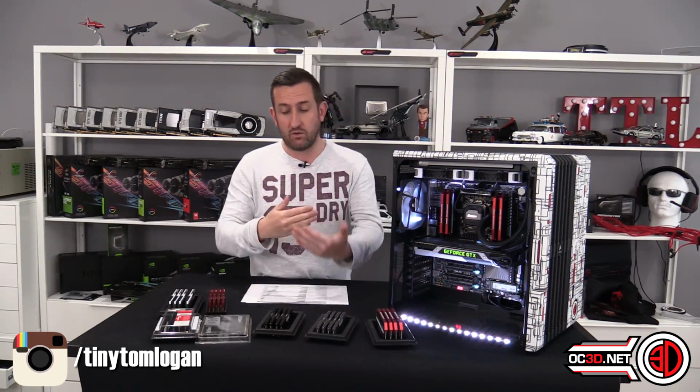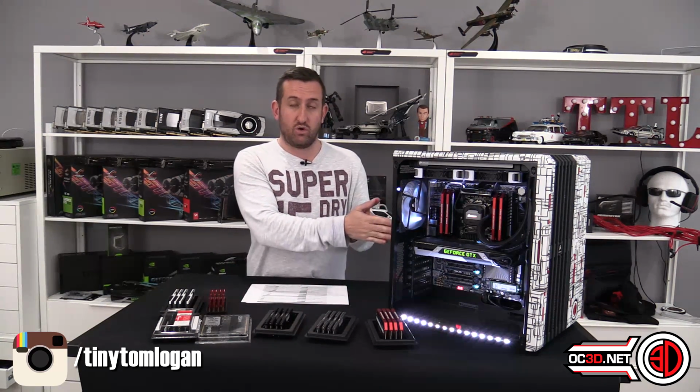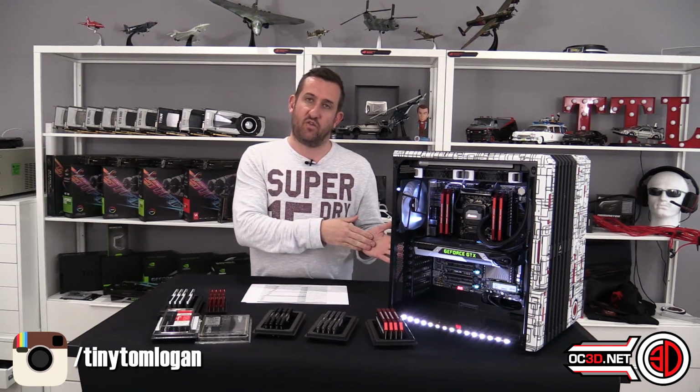One thing I would say though is if you do get problems, you may be on one of the older ones. So if you go to install your M.2 and it's not popping up and you're using Windows 10, update the BIOS first.